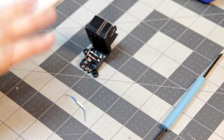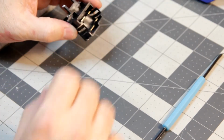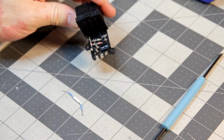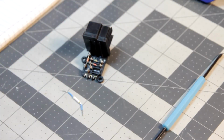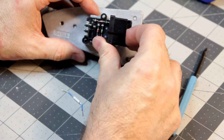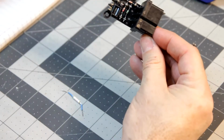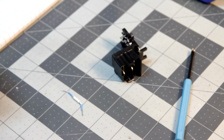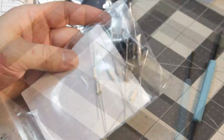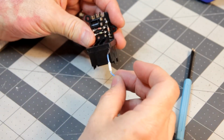Right now, I'm going to see if I have one of these. I think I do. If I do, I'll solder it back in this location here. I'll also put the capacitor back, and then once I get all that back together, I'll screw the transistor back on, solder it in, and that should do it. And then I'll hook it up and test it out before I even have to screw it back in, and we'll see if it works. And as I go along and hit each stopping point, I'll bring you along for the ride and show you where I'm at.